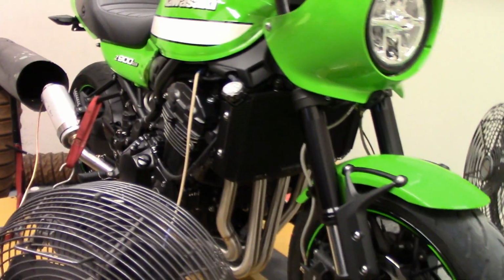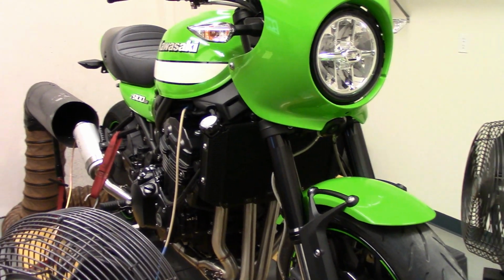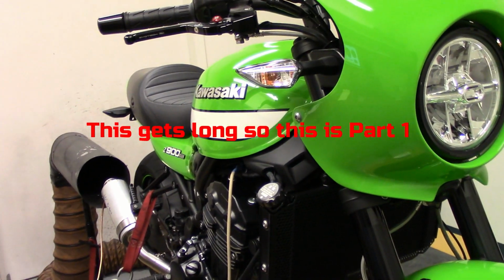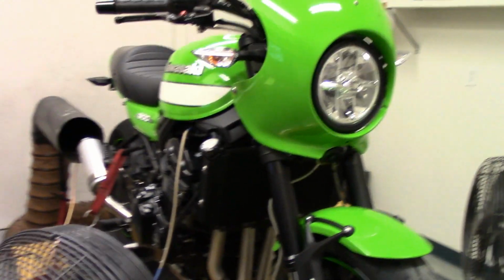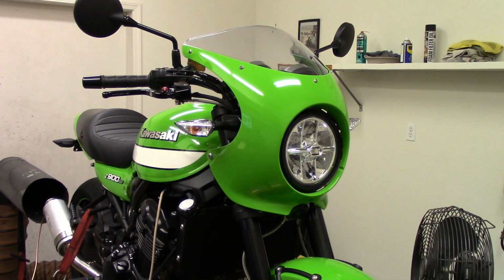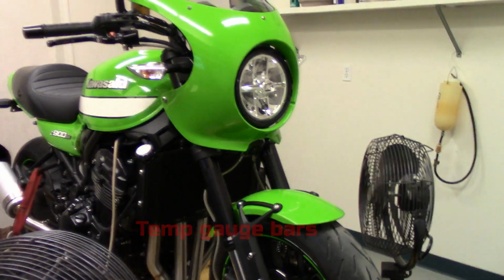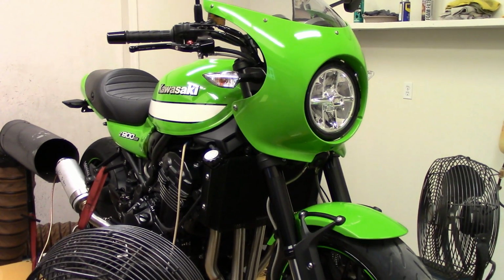But I got to get everything warmed up. Got to run it a while, get the dyno all juiced up, chain warmed up, get everything set up correctly, and then make sure I repeat. Hopefully around 78 to 80 degrees. What I use is 5th gear with the traction control turned off. I start with about the 2nd bar, just when the 3rd bar flickers on, and do my pulls. That's a really good way I found to keep it totally constant. So you get a pretty accurate test that way of repeating. So, it'll take a while.